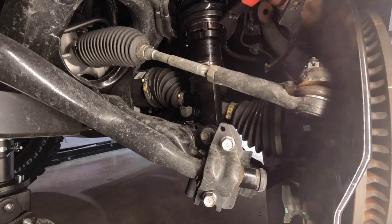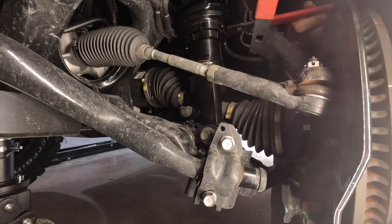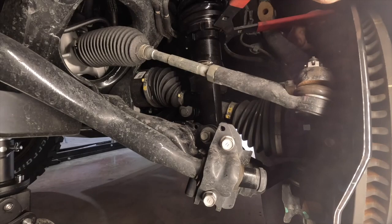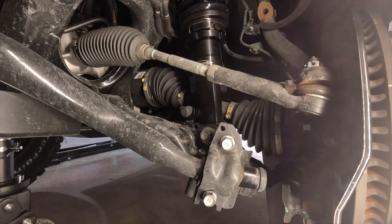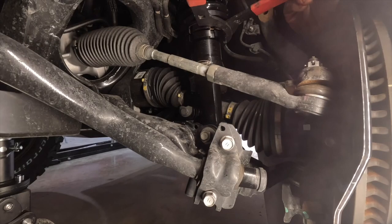Once we get a little bit of pressure off of them, they'll go a little easier. Now you might ask yourself why I didn't just go ahead and set these a quarter inch lower from the get-go. And I thought about it, but the thing is, this KDSS kind of acts a little different on most of these vehicles. It's not cut and dry. It's not something that you can just apply the same rule to every visit, every car. It tends to be a little hit or miss.